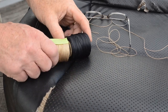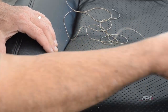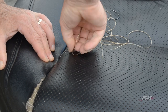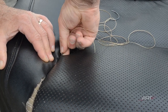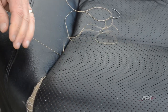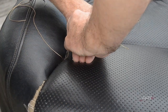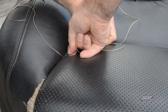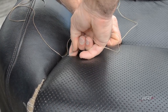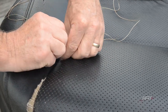Though of course I would normally use black thread here, I'm using a beige thread so that you can see my work. And if this vinyl stretches too much, it's just possible that we will see the thread, and it won't be a total blind stitch. But if that's the case, I want you to see it and then we'll see what we can do to rectify the situation if the stitch is still visible. It was a surprise to me that the rear seat was vinyl and that this was the most flexible or stretchy vinyl I've ever seen in a car.